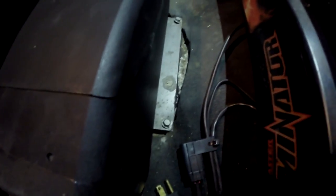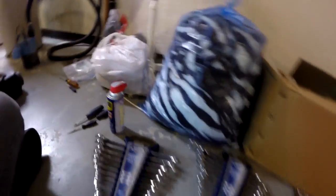This is where my bunk heater is — I'm going to go ahead and take it out. There are two screws on each side to take out. Move that cable there — you can see those screws right there. Once we take them out we can pull the bunk heater out. I've just finished taking it out, so now we're going to take it apart and change the screen. I've got the tools, the air compressor, and some WD-40 to help get those screws out more easily.